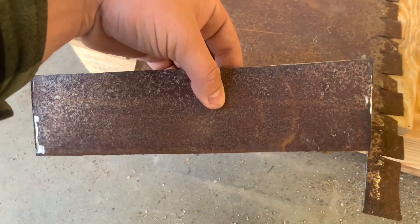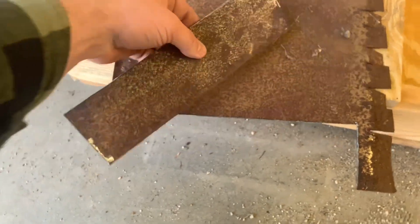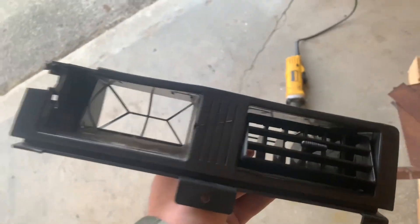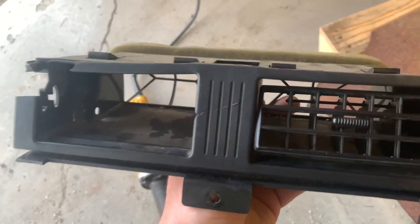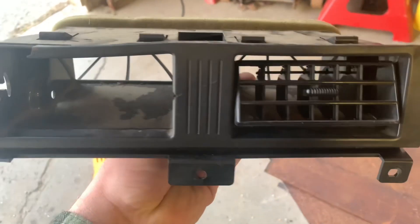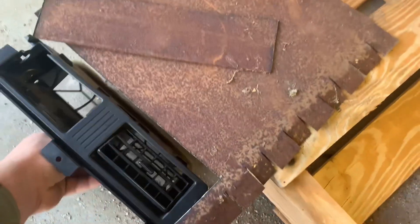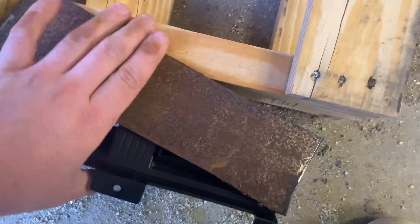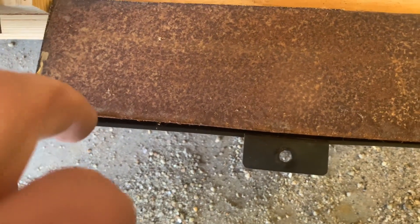So that's step one right there — we just cut out our metal face plate after tracing it out. It's pretty easy. I just had a spare vent, laid it on here and traced out my template. What I'm going to do is make sure in case I don't like the pod I'm making — the triple din, I think it's called for the gauges — I have this old broken piece of plastic and I want to use this because right here I have a mount hole. This notch is in right there for the middle trim to sit flush. So basically I'm going to get rid of the vent and hopefully lay our metal template over the top of this, clean it all up, maybe wrap it in some material. That little slit right here lets my original trim sit flush.